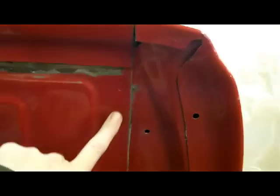And I'm going to get on this and go ahead and get this welded in. So I believe the only spot welds that need to come off are these ones down the side here and along the bottom. The top ones are part of this panel, which comes with the new header panel.